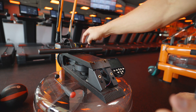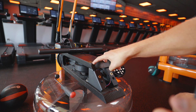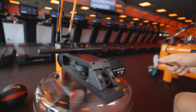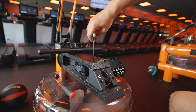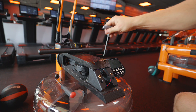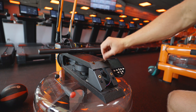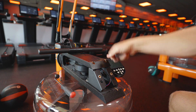The other things that could be the issue — remember that sensor could be off. The sensor is located right below here. In order to get to it, we must remove these two bolts at the front and two bolts on the opposite side of the rower at the very tail end. This entire top board needs to be removed. These two top bolts are a four millimeter, so we'll go ahead and remove those. I do my best to keep them on their respective sides, as every screw has a thread it prefers.